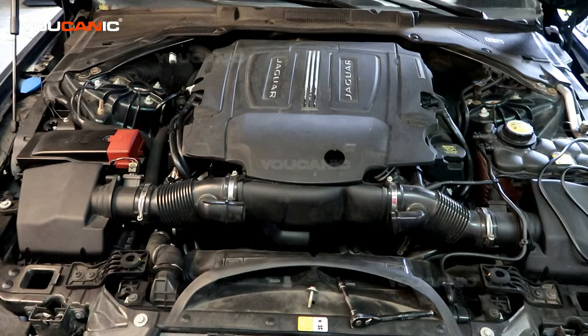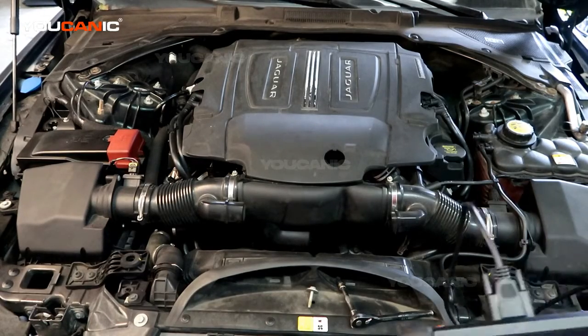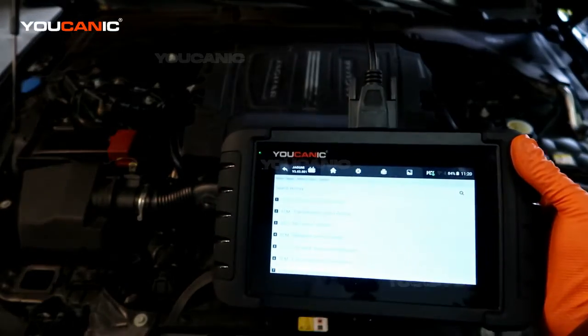One possible thing is to start with the sensors — if the sensors continue to go off, then you might have something more internal engine-wise that will need to be fixed and replaced. With the ignition on to the run position but the engine not started, we have our OBD2 scanner hooked up so you can read that engine code.